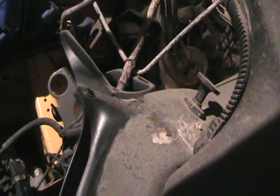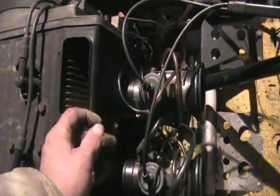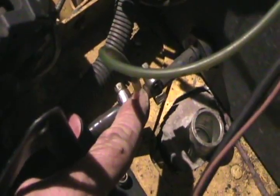First thing you might want to do is get your primer working. The system usually dries up and when you pull that knob in and out, it's not sucking any fuel. The primer just goes to a pipe and squirts a little gas in behind the carburetors to the engine. The way I like to do it is just take off the gas cap, put my mouth on the gas tank opening, make sure there's gas in there, blow in there as hard as I can while sealing around my lips so it's not leaking, and then pump this thing up and down until I can see the fuel coming out. If it still doesn't work after that, you've got to make sure that every connection has a hundred percent seal, because if it can suck the tiniest bit of air from any point, it ain't gonna suck fuel when you start pulling that knob. So use little clamps — sometimes I even wrap some mechanics wire around those little tiny spots since there's no clamp small enough. Make sure there's no cracks in the hose, because that certainly happens by itself when the pipes dry out.